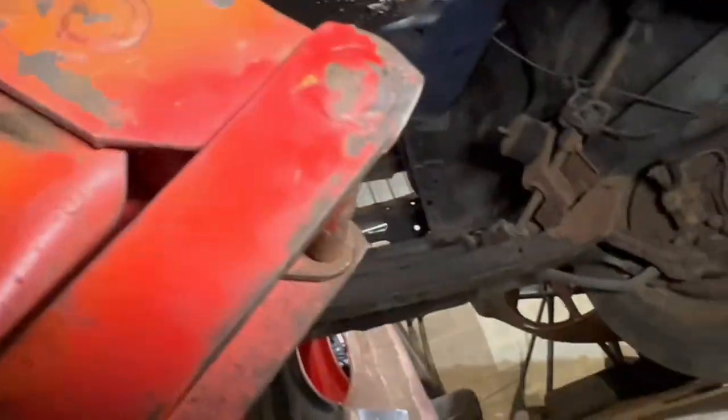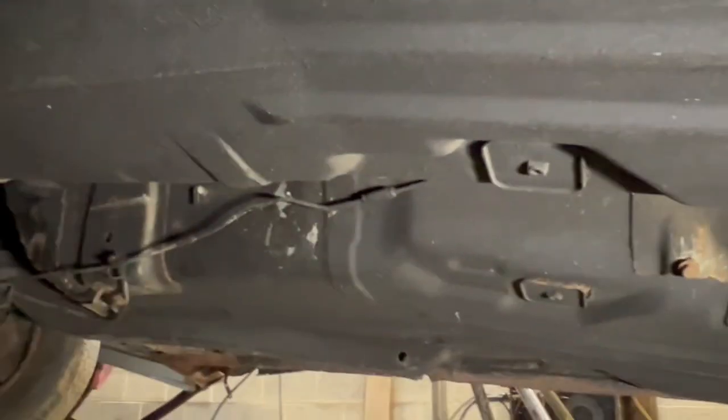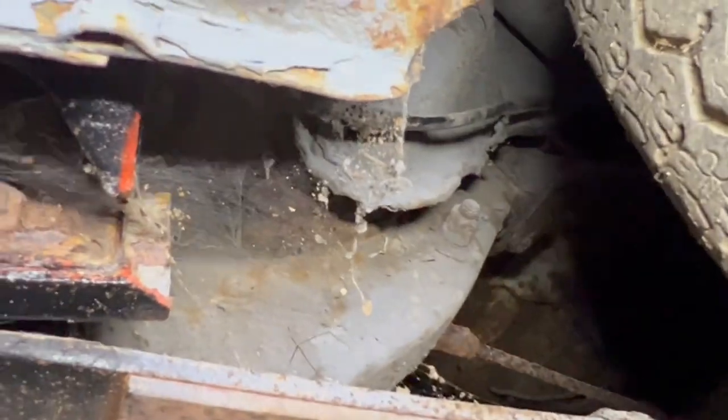So that is original — that joint piece in the middle. Rusty has got that too and I assumed it had a brake line replaced in the past, because the Capris I've had have never had this — it's usually one whole piece. So yeah, that's quite nice to know. Here's that bit from underneath — you could probably leave it and just underseal it, but we're not looking right. The floors don't look too bad from underneath — so maybe the plating you can see inside has been plated on top. And this is the original sill because you can see blue paint.